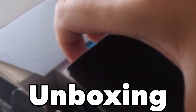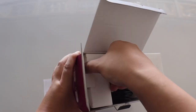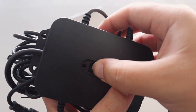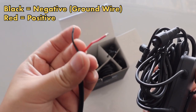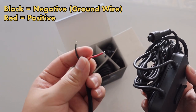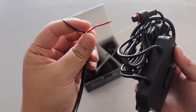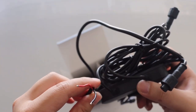Alright guys, let's hop into the unboxing. So inside the box you have your instruction sheet. Now we're gonna unbox the power outlet for the rock light — as you can see, this is your on/off switch. This is your negative and your positive: the black wire is always your negative and the red one is your positive. I'm gonna hook this up to the fuse box, not to the battery directly, because the battery may cause a fire — that is not safe.